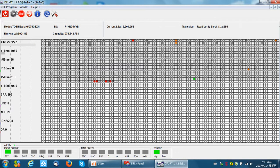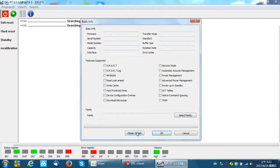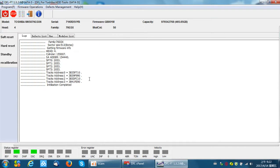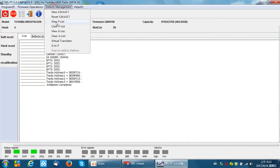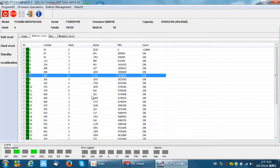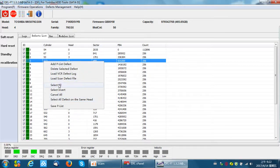Now I go to the program, enter the program, obtain details, click OK. Use ATA mode because ATA mode is much faster. Now let's view the plist. We already have some defect records within this plist. We can clear the plist — select and delete.